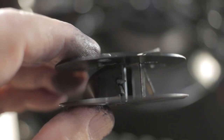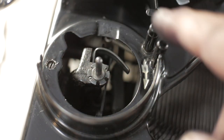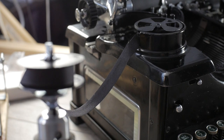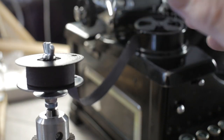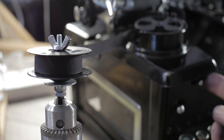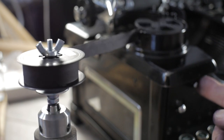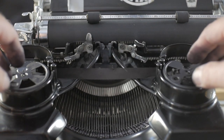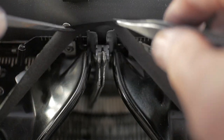I'm going to start the new silk ribbon on the hook of the right-hand ribbon spool. Here's the direction arrow for the left-hand spool — it wants to turn clockwise, and the right-hand spool needs to turn counterclockwise. It's tempting to use a hand drill for winding these ribbons, but it really helps to have an electric drill. With the Speedy Spooler by Bob Marshall and Typewriter Muse, you can operate the drill one-handed while using the other hand to free up the left-hand ribbon spindle. Left-hand spool, right-hand spool, ribbon through the guide — set it to red, lift up two type bars, and thread the ribbon onto the vibrator.